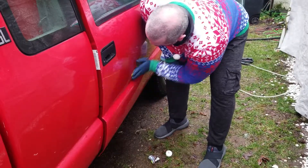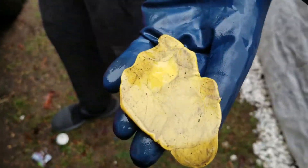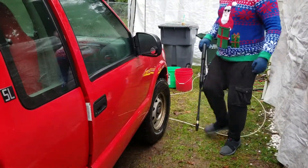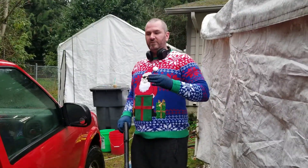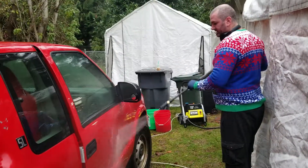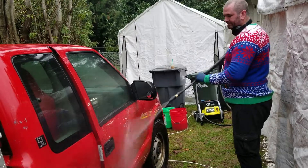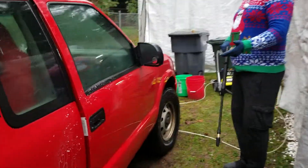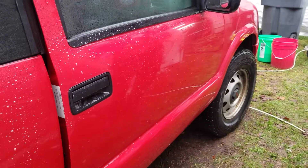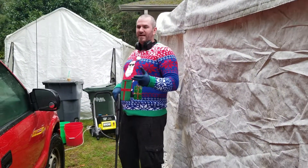You can do this on your windows and your plastics — you can decon pretty much everything. But you can see all the crud that was on there; that's what's stopping the surface from being hydrophobic. Hydrophobic is just a resistance to water, and if you have a flat surface you should get a hydrophobic quality from everything. We haven't polished this yet, but look at the hydrophobic qualities just from deconning the surface. This is a phenomenal example of what is actually on your paint that you can't see.